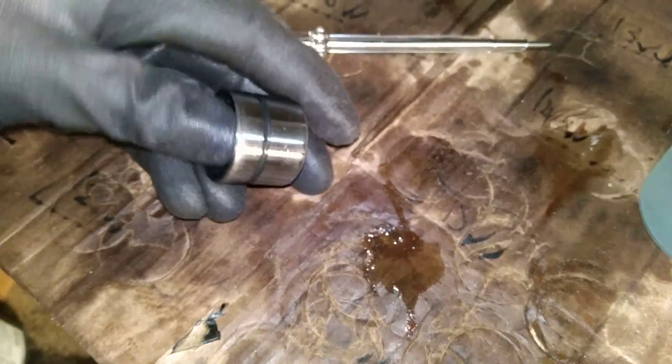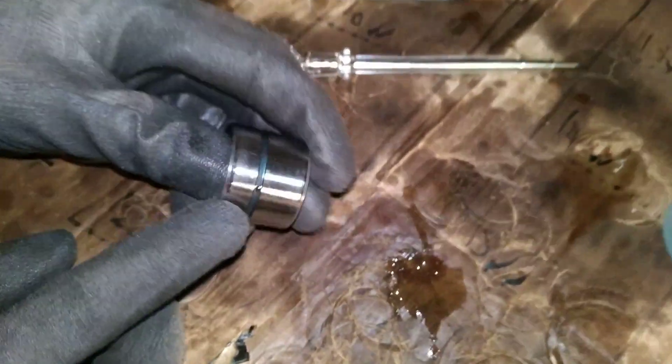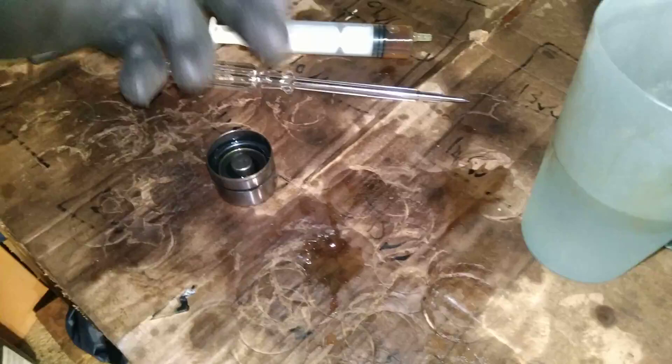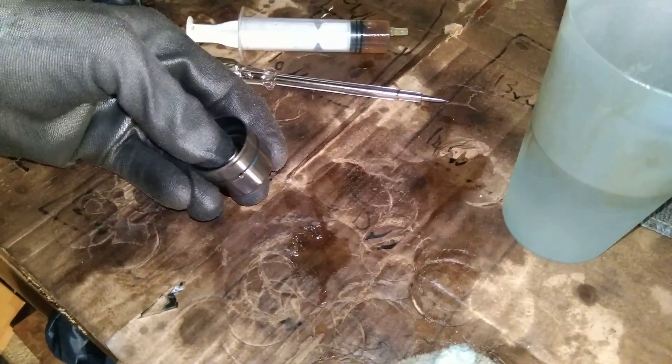Once you've done this, put the whole thing submerged in oil. You'll see there's a hole on the side — just keep actuating it in the oil and that'll get any final bits of rubbish out and you'll feel it go nice and smooth. Submerge them in oil overnight and that'll help fill them up before you fit them to the car. They may run a little bit noisy at first but then, hopefully, that should resolve any tapping noises.